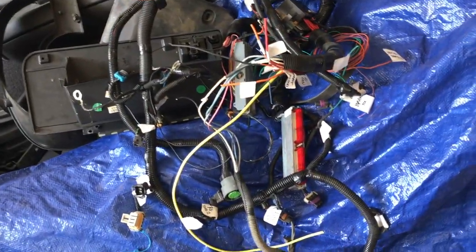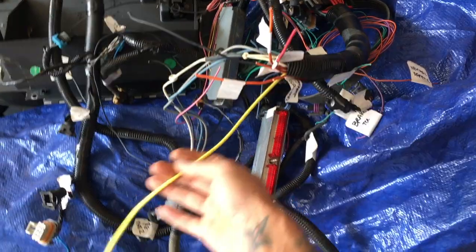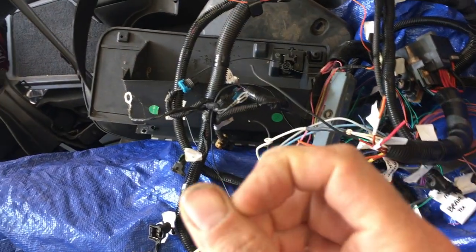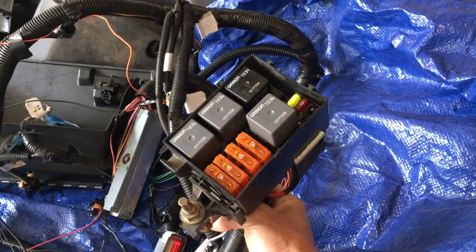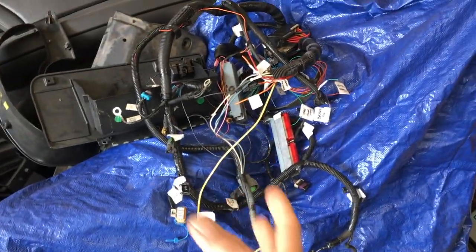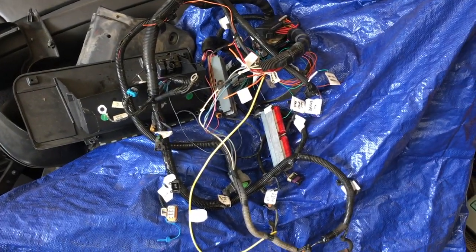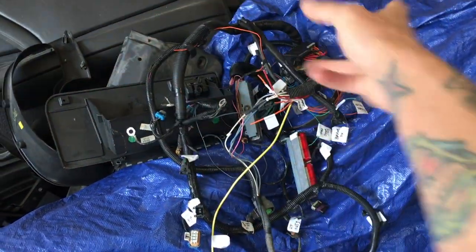So I finally got the wire harness completed, stripped out all the sensors I don't need, and then removed the original harness so that I could label off the wires that go inside the dash separately — starter wire, fan wires. I'm going to reuse the fan and possibly the radiator from the Camaro. I reused the fuse box as well, got all the fan and starter relays in there as well as main circuit fuses. Most of it was on lt1swap.com and then a few other forums with pictures. Just strip out what you don't need, tape it back up — as long as you don't mangle it too much, it stays in its general shape.